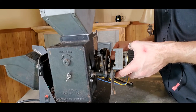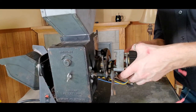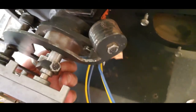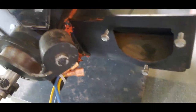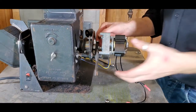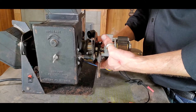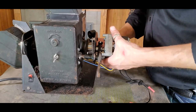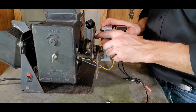Once the new motor is in place and pushed all the way in until it bottoms out, and the flat edge is lined up with the bolt, tighten it just a little with your fingers first. Then make sure the roller on this is centered within the arm. There's a little bit of play with where that can be, so we want to make sure it is centered within the arch arm. Once everything looks to be in proper alignment, go ahead and tighten that up — I don't need to reef on it, but I do want it tight.